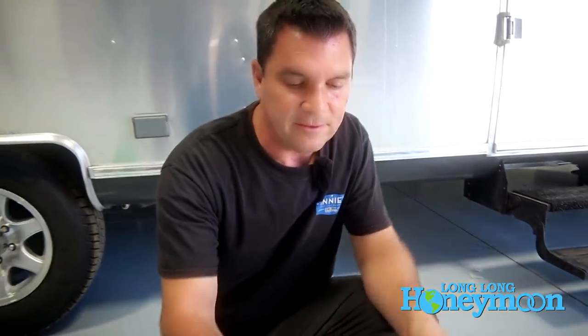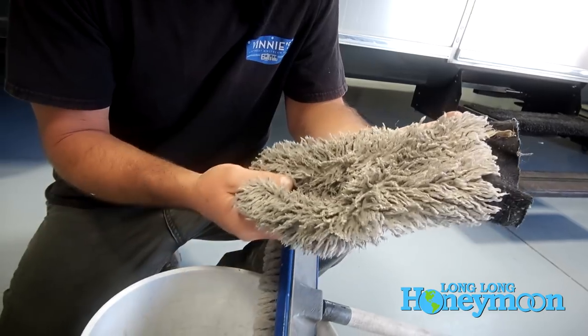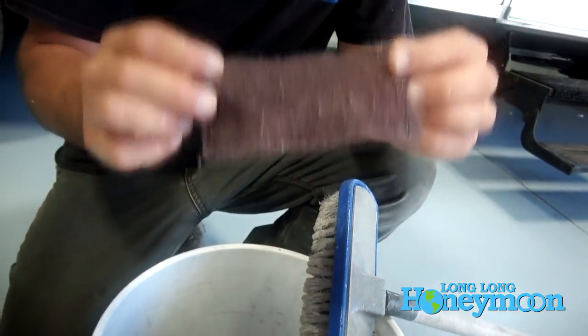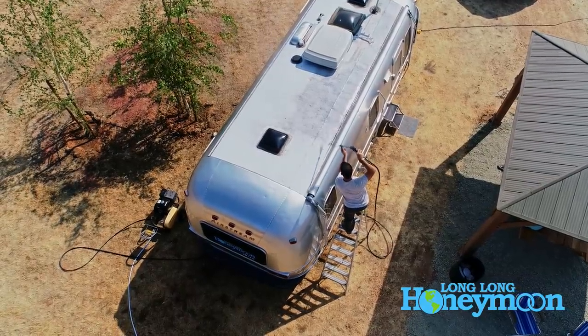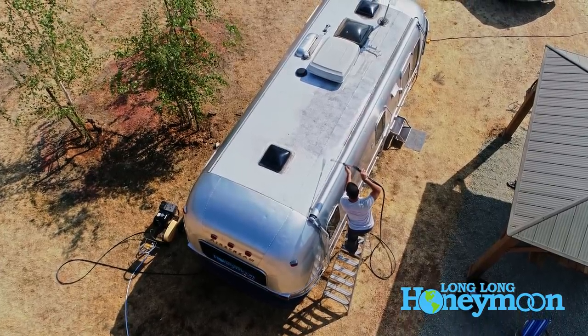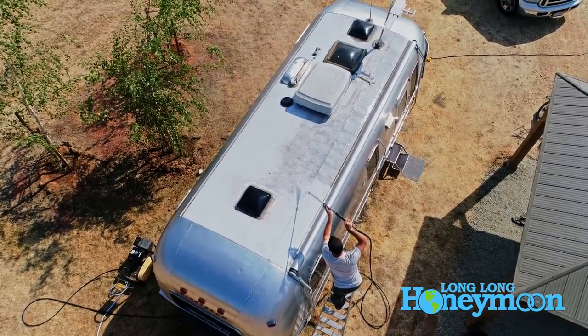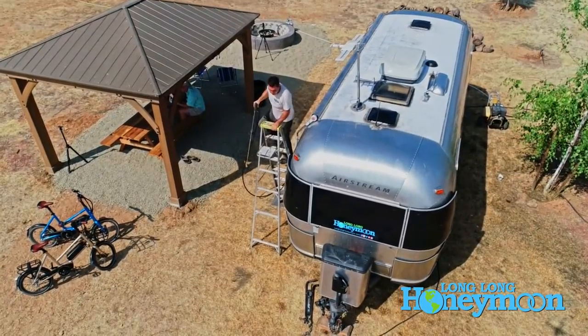If you have to go a little bit more aggressive, you can use a wash mitt and scrub the roof surface. In our case, recently washing the roof of the Airstream, I had to use a Scotch-Brite pad — now be careful with this as it's a little more abrasive. If you're washing a fifth wheel or travel trailer with a rubber roof, there are products that clean that rubber material that may be superior, so check what your dealer recommends. Use a soft brush especially around the vents and anywhere where the roof was cut to install a roof vent or cover, so you can inspect those seals.